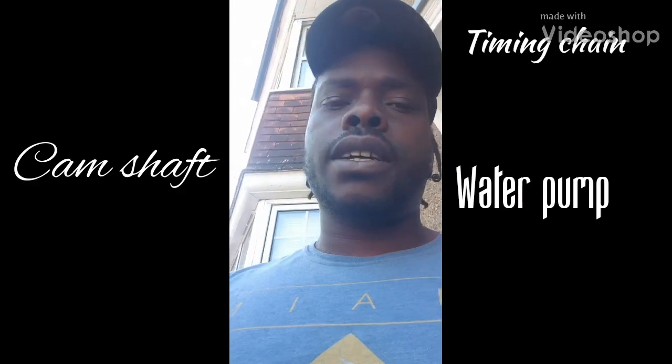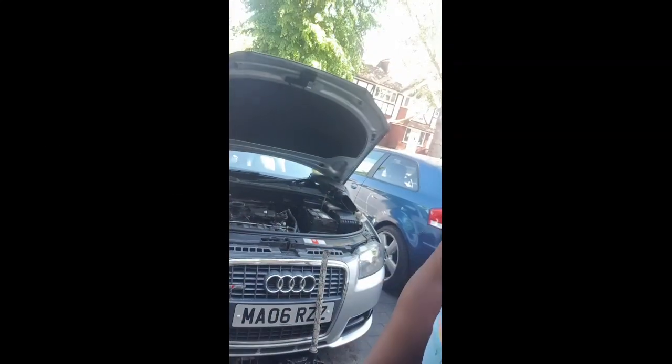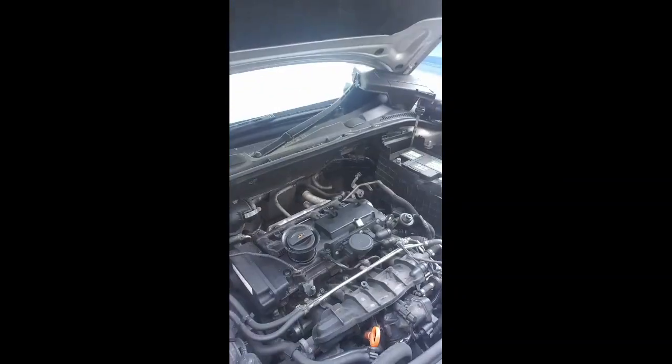What's going on YouTube? I'm going to fix the Audi today. It's the 2 litre TFSI - same engine you can find on the Golf GTI, the Seat Leon and the Jettas and all of these cars. On this car I've got a hesitation when trying to boost, and what I've found is a camshaft that the high fuel pressure pump runs off of - it's a bit worn because of a failed high pressure fuel pump follower. So I'm going to replace the camshaft, the timing chain, the timing belt, the water pump and the gaskets. I've got someone that's already bought the car with a deposit down, so let's get it done.